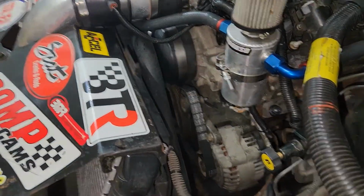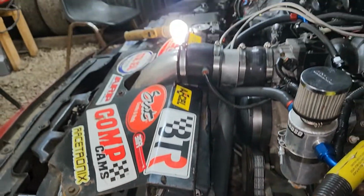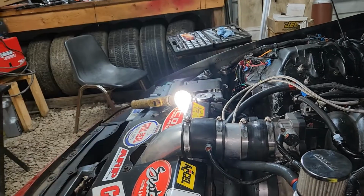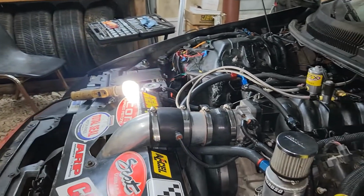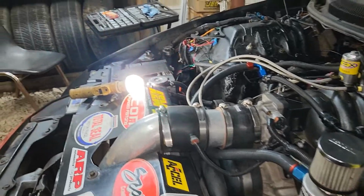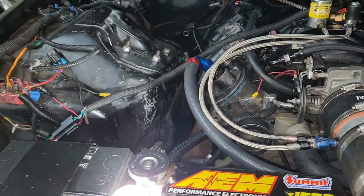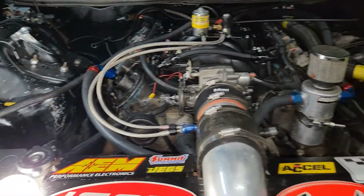And I'm going to take the radiator hose off from there. I'm going to hold it up here real high and fill it up real good. And then I'm going to use that Mountain Dew bottle I stick down here with tape in it so I can fill the water level up real high and let it burp itself, and we should be done.